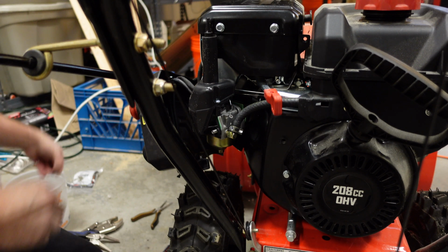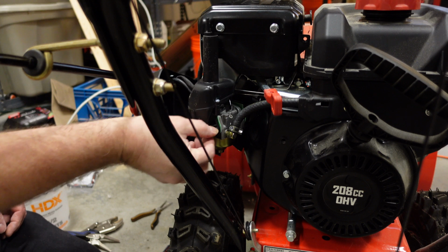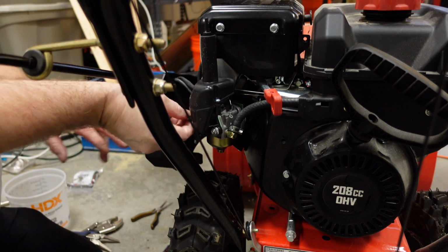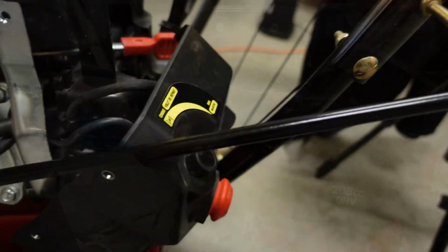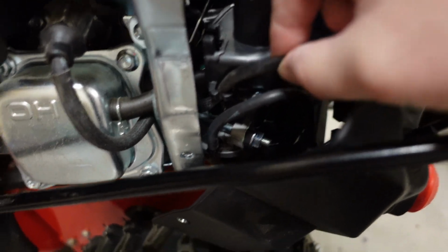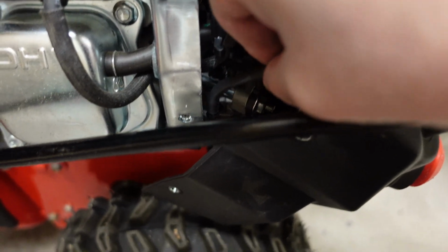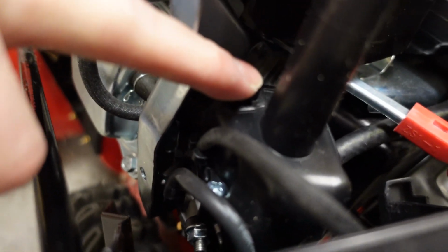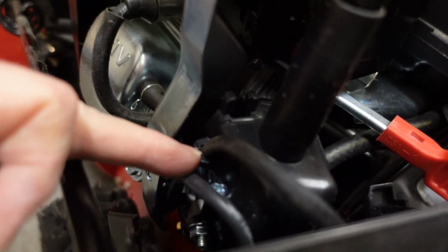I love that all the nuts are always 10 millimeters in this whole engine, which makes life a lot easier. You don't have to change the size of the socket or the wrench or anything that you're using to tighten these up. To show you, there is a flat hose here. If you squeeze it, it's just flat. And then there's a kind of one that's just circular, it's round and you can't squeeze it. So with the two clamps, this one's got a narrow opening here. So the flat hose is going to go into that one. This one's got a wider opening, and so the circular hose is going to go into that one. So you're going to know which hose to hook onto which clamps. So just remember that the fat round one is going to go to the top one, at least in this case. And the narrow opening flat one's going to go into that one.